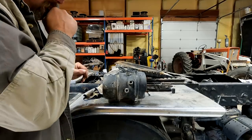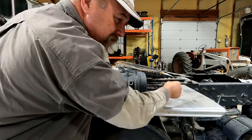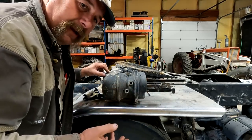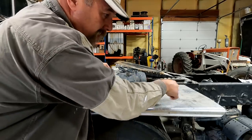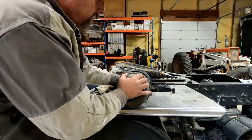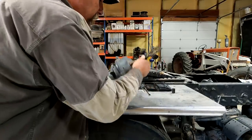Okay, what we did is we got in here on the slack adjuster and ratcheted the slack adjuster loose so it could travel. The problem is every time you back up and hit the brakes, that will ratchet and readjust, self-adjusting slack adjuster will readjust that brake. So what you do is you take right here on the side of almost every, this is called a maxi.